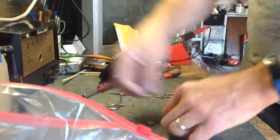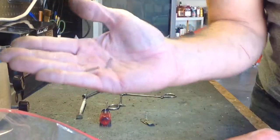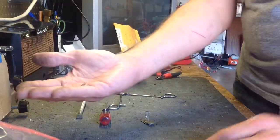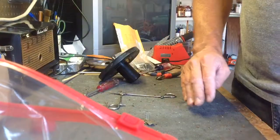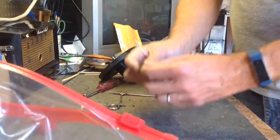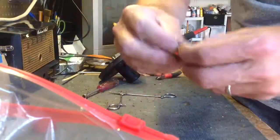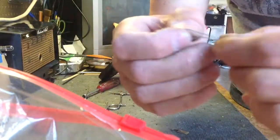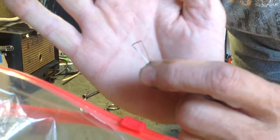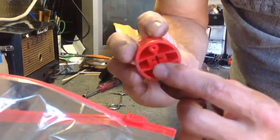You have two little springs that go into those Bakelite shelves that you don't want to lose. And one of them just got away from me a little bit, so I'm going to have to figure out where it went. That's not good. Anyway, you have these knives which slide in and out and let the records drop, and then there is this little spring that sits on top of everything, and that spring goes up into this slot in the top of the nose.